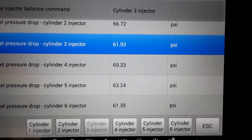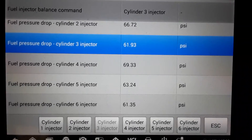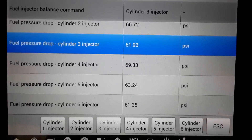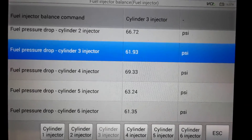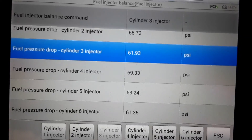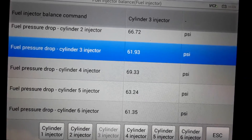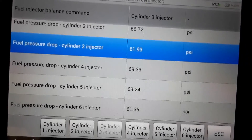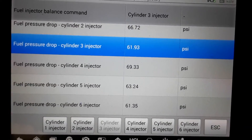The injectors for these direct injected cars are a lot more expensive than a non-direct injected engine. So it's a good idea to run top tier fuel in these cars. I don't do any additives — I don't believe additives really do a whole lot, unless it's something you can continuously run. Top tier fuel actually has additives in it, so if that's all you run you're continuously doing everything you can to keep your injectors clean.